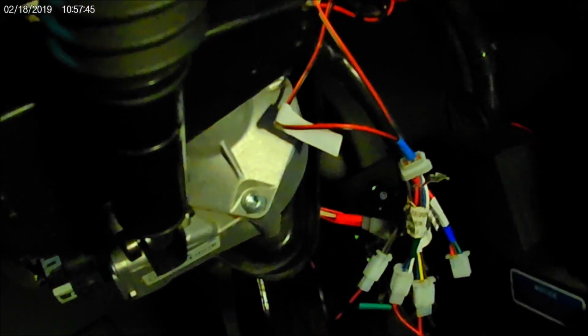I was able to slide a fish tape in there, grab onto the wire, and pull the wire through, and the wire comes in along with the rest of the wiring here on the inside of the unit, and I'm just following the cable routing right on down. I had to take the console apart so I could get the cable routed up through the console, and I ran about out of wire for the light. But then it follows the wiring right up to the head of all the turn signal connectors. So anyway, that's the report for now.